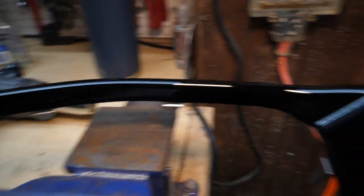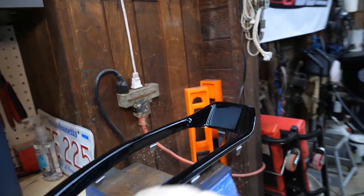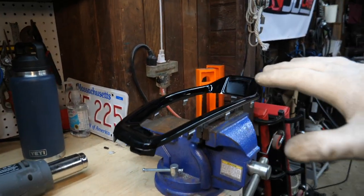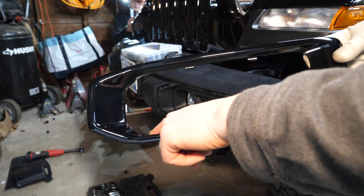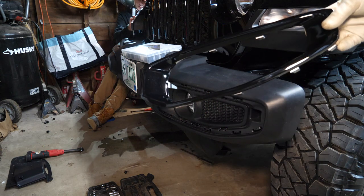Interior lines are looking good. And yes, we do have a few little flaws like that, but everything goes according to plan. That's gonna be recessed and hidden, so it's not really gonna matter. I am quickly gonna go over this and post heat it just so that the final takes shape and doesn't try to go back to being flat. And I've made sure that all of our edges are really firmly pressed down so they don't catch and cause the wrap to come off.